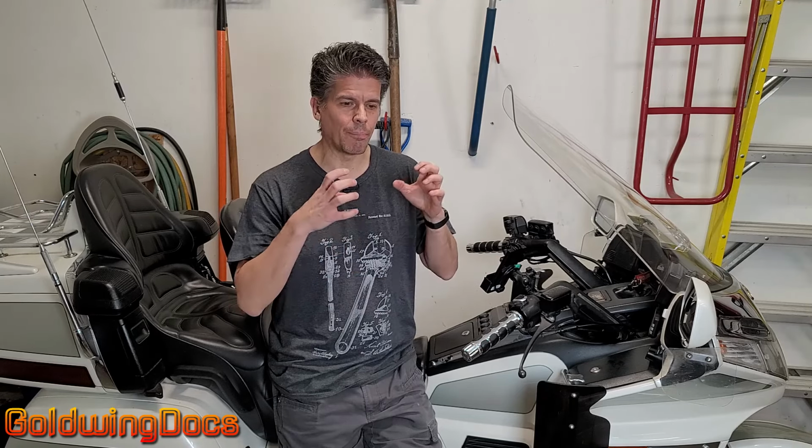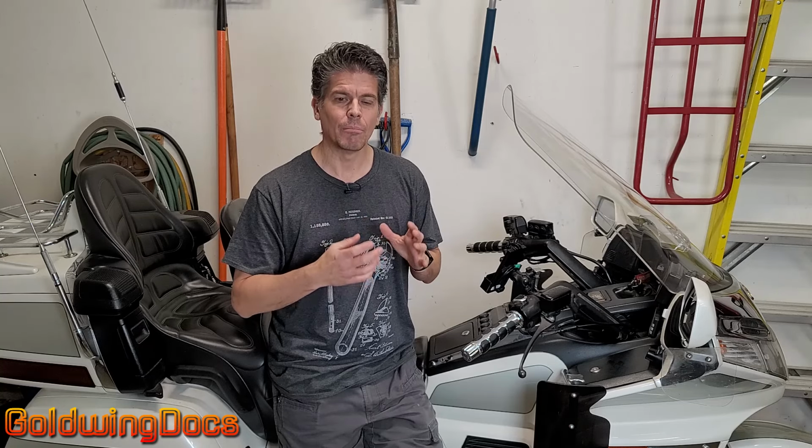As long as it hasn't gotten too far where the sprags are so bound up with solid gunks of sludge, in most cases, this is enough to actually fix the problem. And by doing it once a year, I do it as I put my bike away for the winter, it prevents it from collecting enough for it to ever become a problem. Most people that have this problem, one treatment of Seafoam in the oil, go out, gentle ride, drain the oil, problem solved.